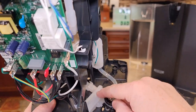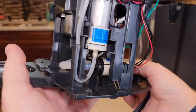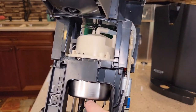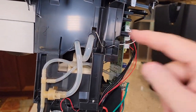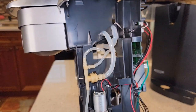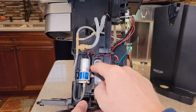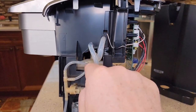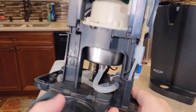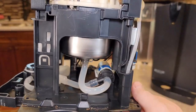Water is going to come in and go to the add water sensor or to this box — I'm not sure what that box does — but it goes that way to the pump. There's the water pump. From the water pump it outputs to the bottom of the heating tank, and then it comes out the top of the heating tank and goes right to the K-cup. Then you've got the air pump — Keurigs typically have an air pump. Towards the end of the brew it turns the air pump on; you know it's an air pump because there's just an output, no water intake. Air goes into the top of the tank to clean out the top and the tubes to get the rest of the water out. This Keurig was heavily used — I bought it used — but I don't see any buildup in the tubing, no mold or anything that looks remotely dirty.